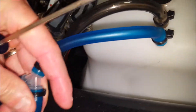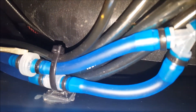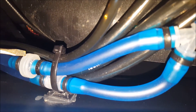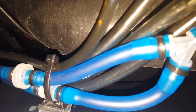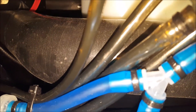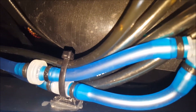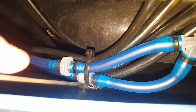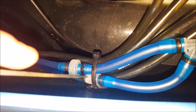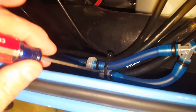This last line goes to a Y-splitter. Down in here we have your inlet valve — it's got a little arrow on it and lets air into the tank as the fuel goes out. And this one here is your pressure relief valve, which lets air out of the tank that builds up over 4 PSI. It's very important to have this on here. They did not start putting these on until midway through production, so if you have an older ski, definitely order these up off our website.